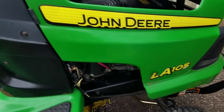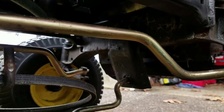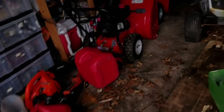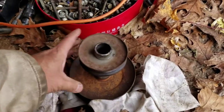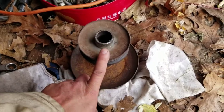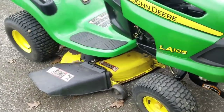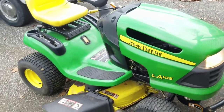I've got to find the right double pulley for the crankshaft. The double pulley I have is the smaller one, and I think I need the bigger one because if I install the small one I don't think my mower deck is going to work — the belt's going to be too long. So I think I need the bigger pulley.